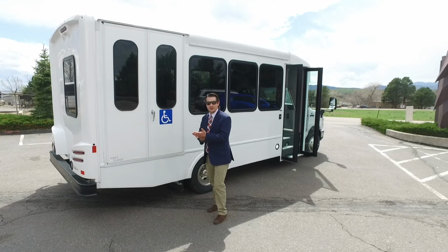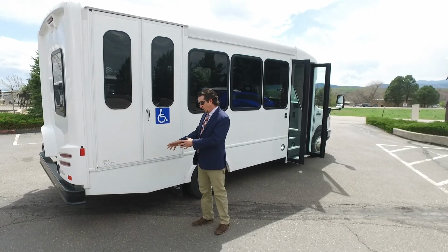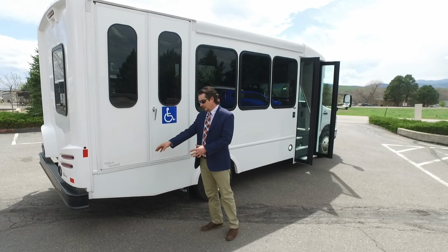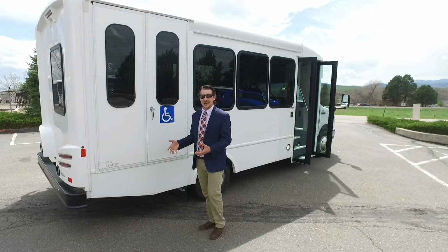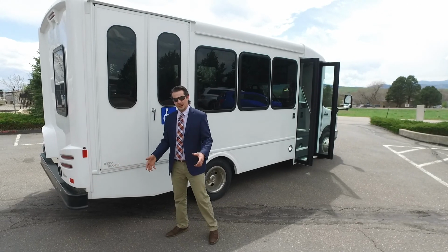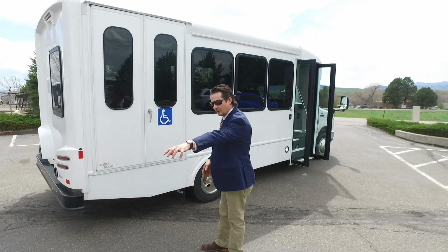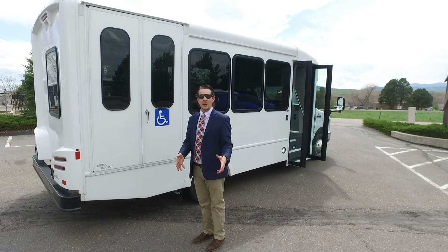We're on the back side of the vehicle here. One big thing that we're noticing is missing here is the absence of a tailpipe spewing out exhaust right underneath the wheelchair lift door. As standard, it's hard to believe, but the exhaust port is exiting right underneath this wheelchair lift door. Typically, we're going to bring a wheelchair occupant over, we're going to get them kind of here and then maybe one more in line, deploy the lift. What an awful place to asphyxiate our passengers from.